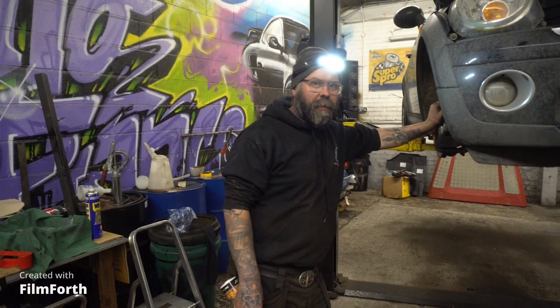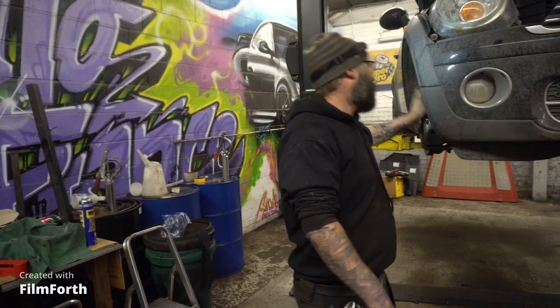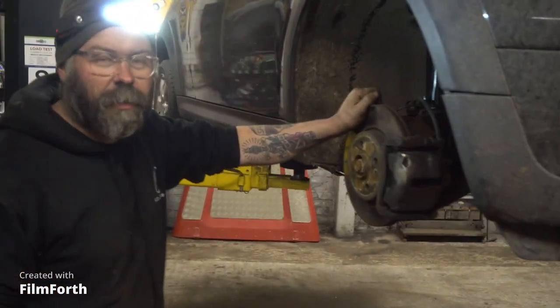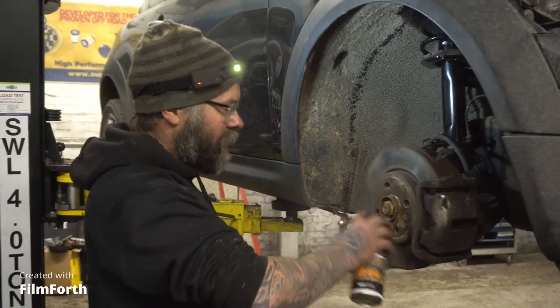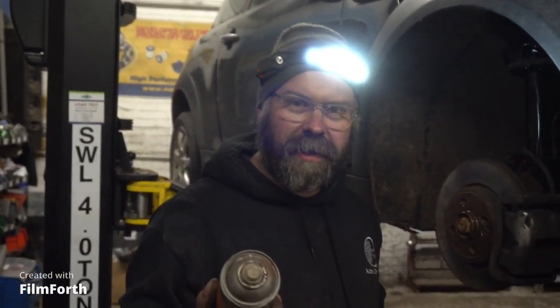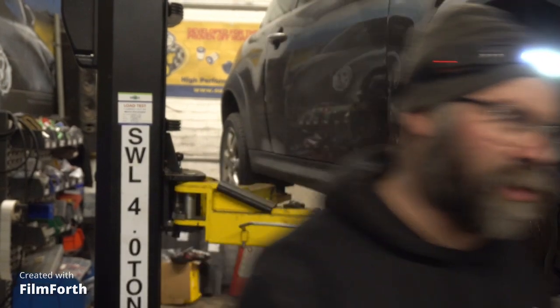Yet again you lucky people have experienced the Heartbreak Garage time travel machine, and I have done the other side — it's all there. I've gone round and made sure everything's tight and torqued up, and I haven't just relied on my impact tools. We'll give it a bit of a coat with the aerosol. Copper grease is only to be used to stop things seizing up — don't use it on drive shafts or moving components because it acts as grinding paste. Just so you know.